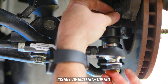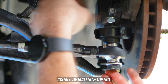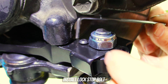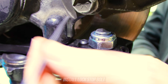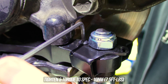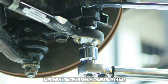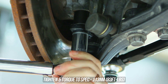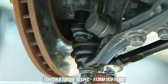Once you've figured out your bump steer and Ackerman position, throw the tie rod through the guts of all this goodness whilst winding the nut on top. Before tightening the main bolt, install the little bolt that goes into the lock stop — make sure the lock stop is lined up to stop where you need it, then tighten that down to the specs shown on screen. Head to the main bolt, hold on one side, tighten and torque those down to the specs shown, then torque the two main bolts running through the ball joint assembly on each side to the specs shown on screen.